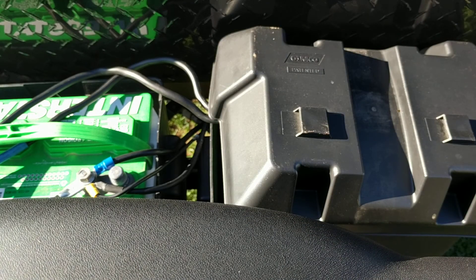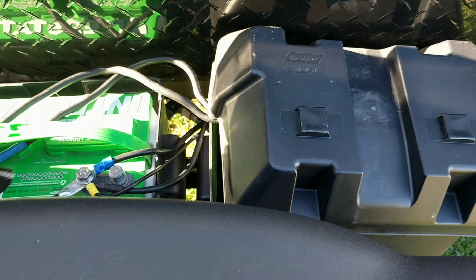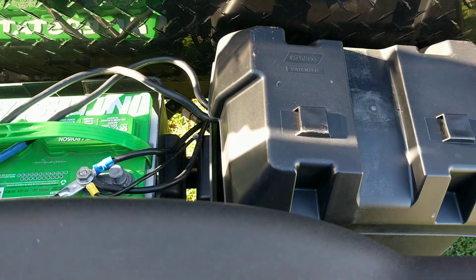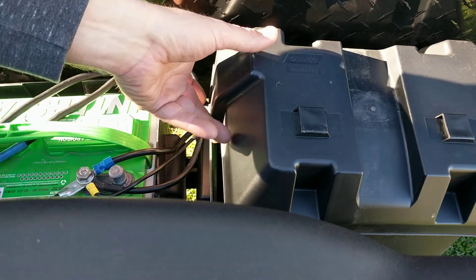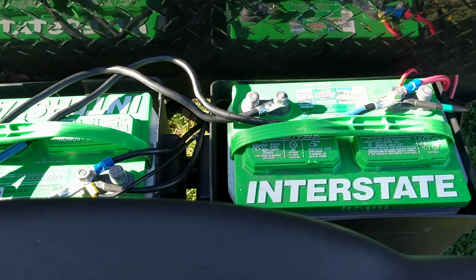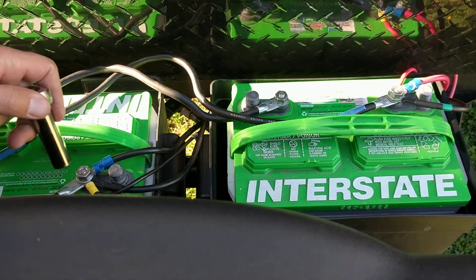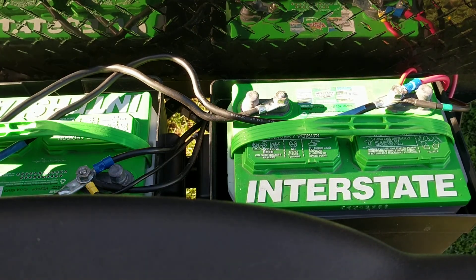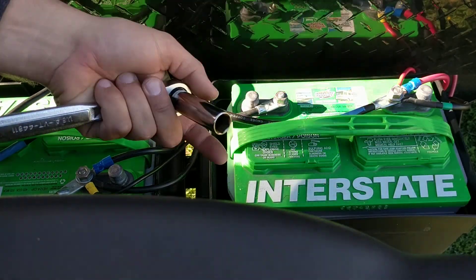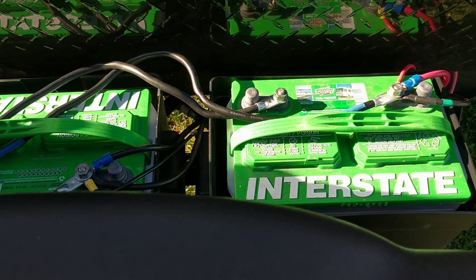That's pretty much it. I got the strap switches that just run across and you strap them in on both of them — no problem. They really have no problem here because the wind is kind of blocked by the propane tanks and stuff. Easy and simple. Snug everything up with a 14mm wrench. You don't want to over-tighten it either, because then you're going to pull your studs out of the battery and you'll have a worse connection than you did. Pretty simple and easy way to do it.